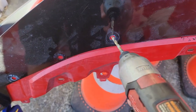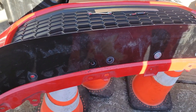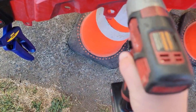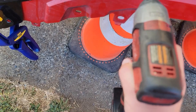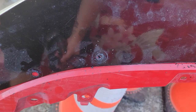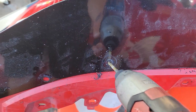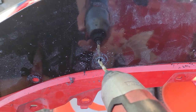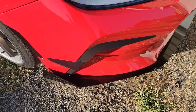When drilling these holes — essentially any of them except the bottom two — just be careful because the bit will pop through the top if you're not paying attention. You can feel when it punctures through; you don't even need a lot of pressure. Literally using no pressure and it starts drilling out. Then just barely push and it pops right through. Because the bit's a little small, I'm just working it around to open up the hole.